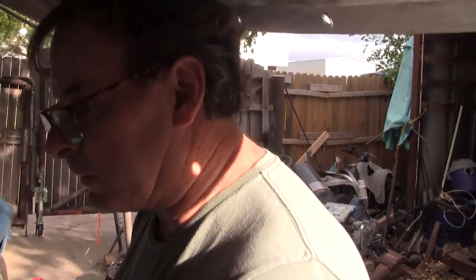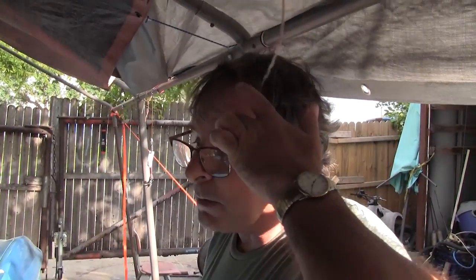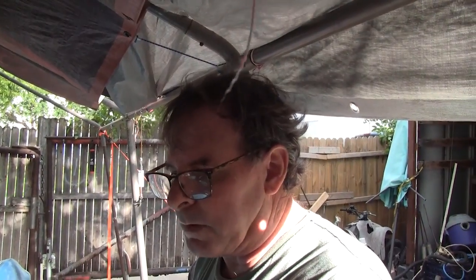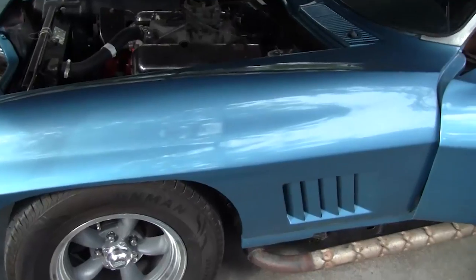And when I took it out for the first drive video, it was running real crappy, and some people said, man, it really just sounds like garbage. And it did, but it was open exhaust. So I pulled the valve covers off and checked the adjustment on my rocker arms, and they were way off. It's a solid lift cam, so there's no reason for that. These were about 20 thousandths just last night. Now some of them are about 45 thousandths. It had worn down that much. But anyway, I put a new cam in it, and it's a lot more mild cam.